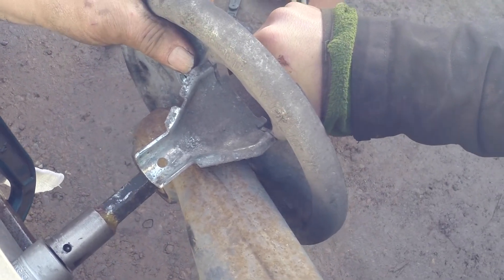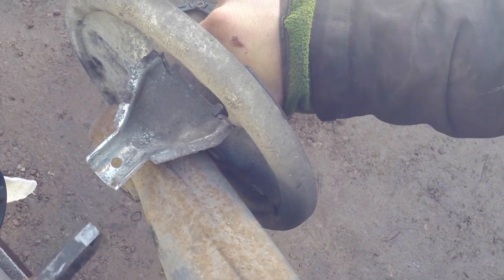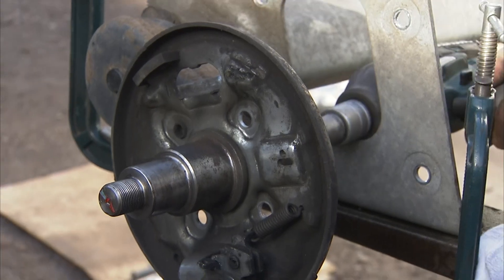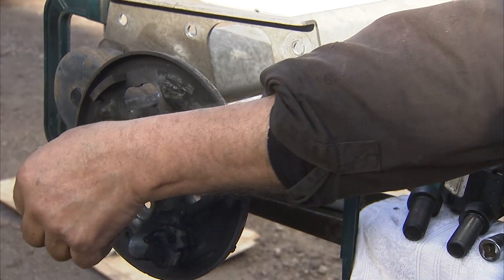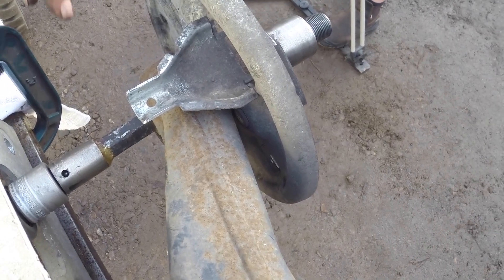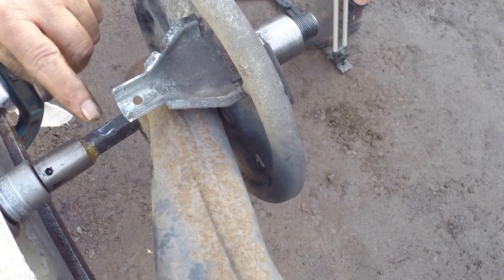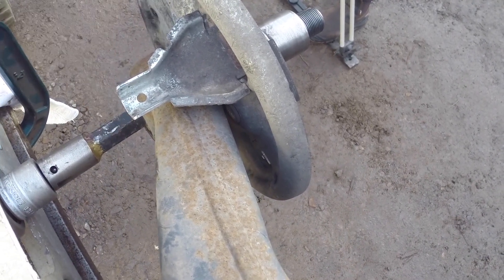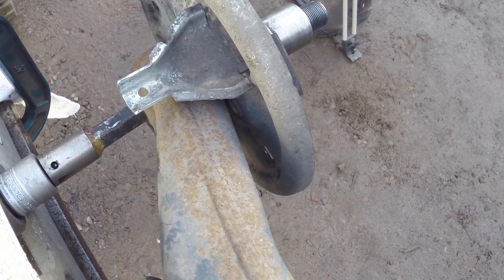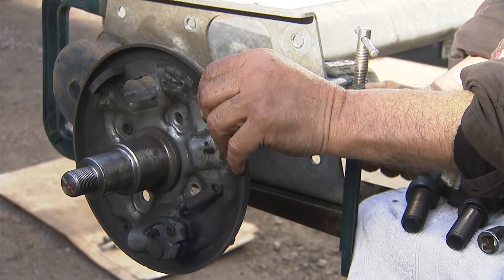So that is it in — 2 seconds and that is it; that is all you need to do. If you have a slack stub pin where you go to tighten up the nut and the whole thing turns, all you need is this tool: a three-quarter inch impact wrench, 17mm Allen key, and 2 to 3 seconds and it is tight. Don't labour with the trigger, just 2 or 3 seconds and the job is done.